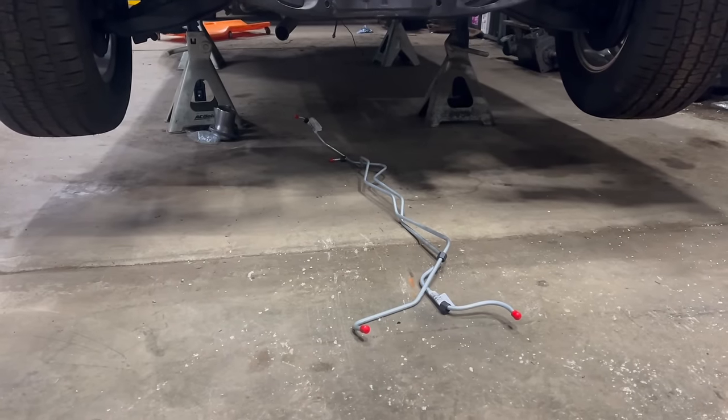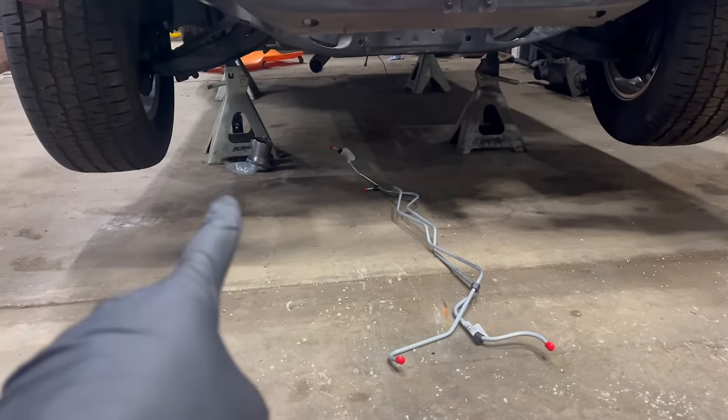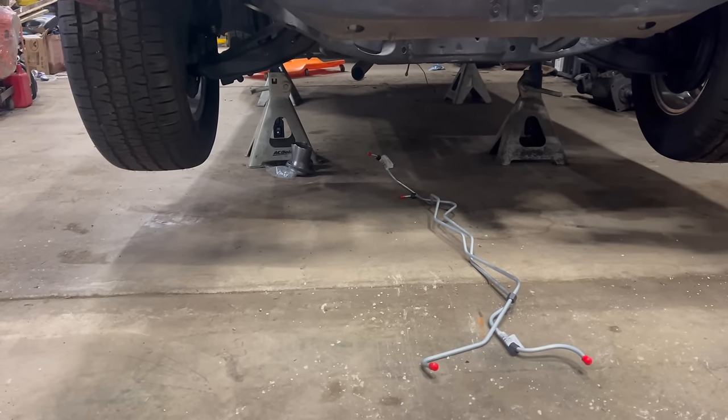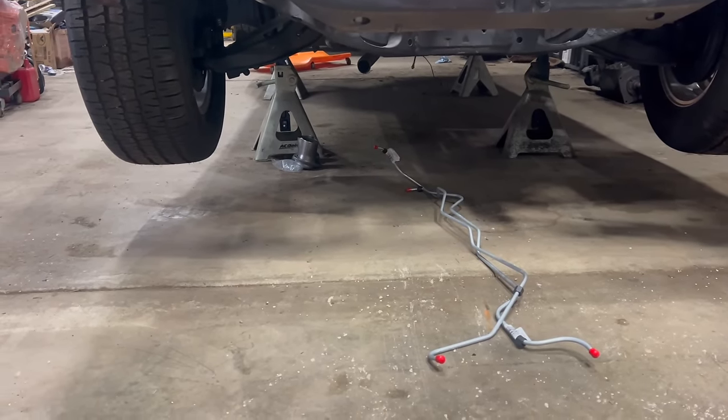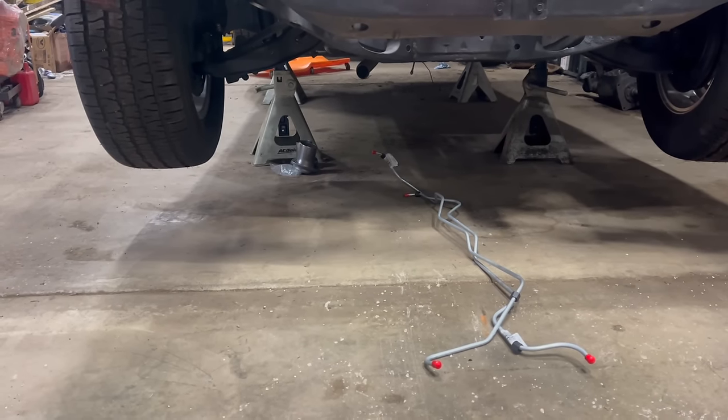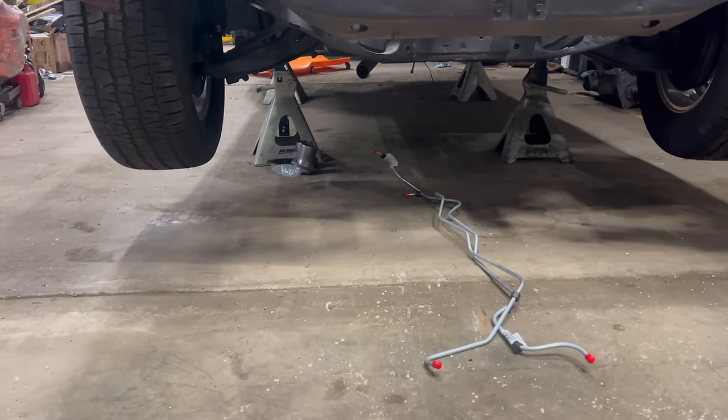I've moved on to things underneath the car. I'm gonna install the flanges for the exhaust guy, and I need to get the transmission cooling lines in. Probably should have done those when the engine was still loose because it doesn't seem like they're gonna wanna slide through their little spot. Then the starter needs to go in, the shifter cable, the kickdown, etc.